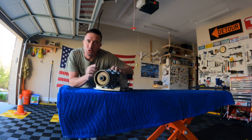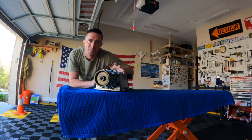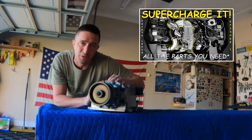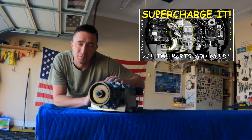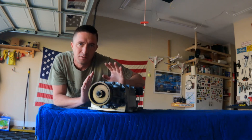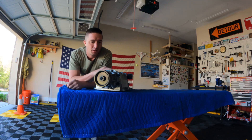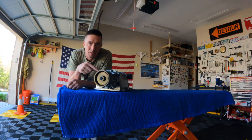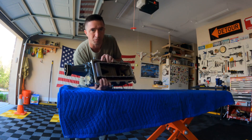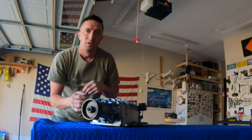What's going on guys, this is episode 2 and we're going to prep the M112 supercharger to get it ready to go into my Lexus GS 400. You've probably seen episode 1 by now — if you haven't, go back and check that out. That's all about planning and everything you're going to need to get this job done correctly. Today we're going to drain the oil out of the snout, take the whole snout off, pull the rotors out, and we have to cut the intercooler flange off.